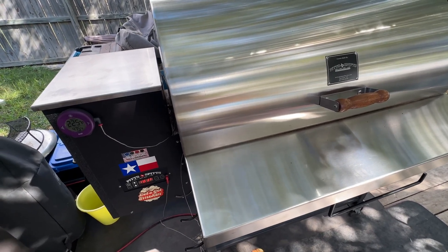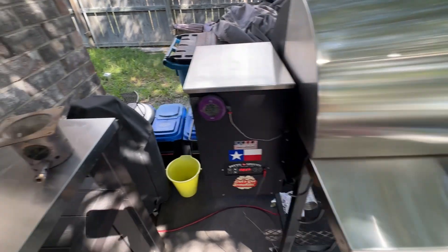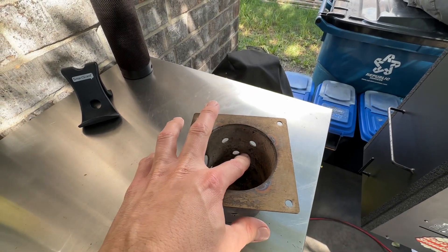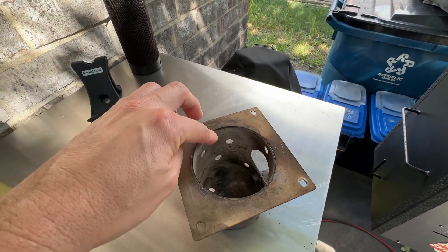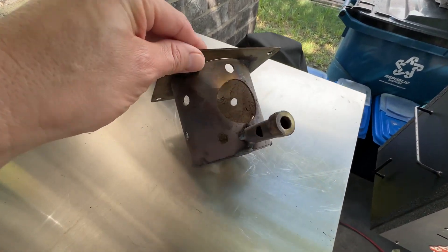The original U1.10 firmware came with the seven-hole fire pot. Here's an example of the fire pot — this one's modified. You have three holes here, three on the other side, and then one on the top. The secret here is adding these two additional holes, one on each side of the igniter.